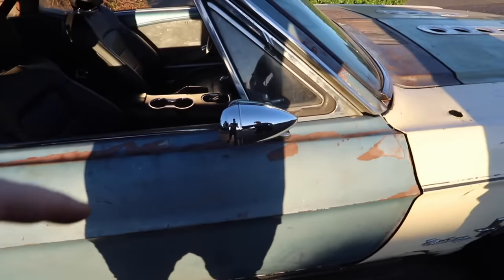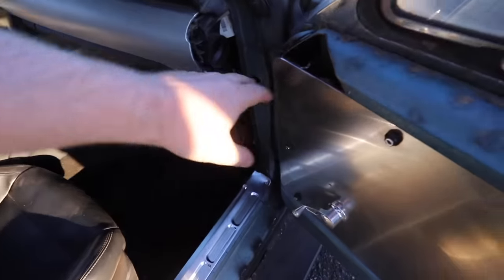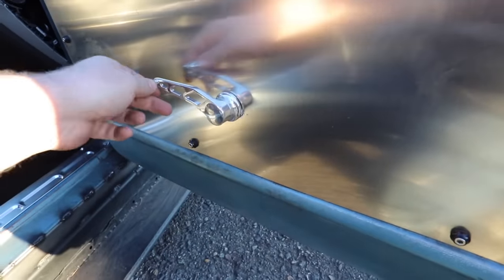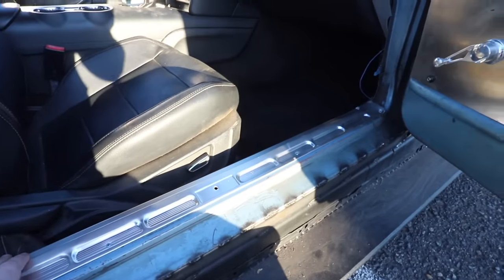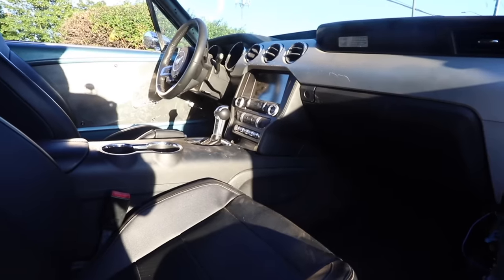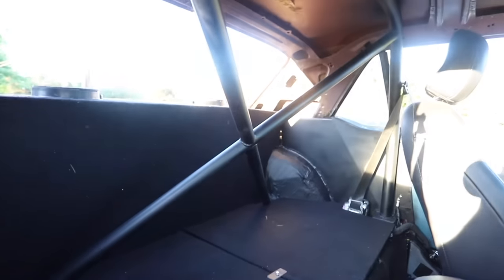New handles, new locks, new side mirrors. Jumping into the interior — we didn't finish out every little detail, some side paneling still to go, but other than that it's pretty clean looking in here. It's a 2016 interior with custom-built door cards and hardware from Downstar — shout out to those guys, we'll put a link in the description, and we're going to use this a lot in the other Mustang. Really nice billet door handles and window rollers, which are super dope. We also took this chrome piece and spray painted it with matte clear so it wouldn't shine too much. We worked with the FORScan tool to turn off all the TPMS stuff and kill the MyKey issues.